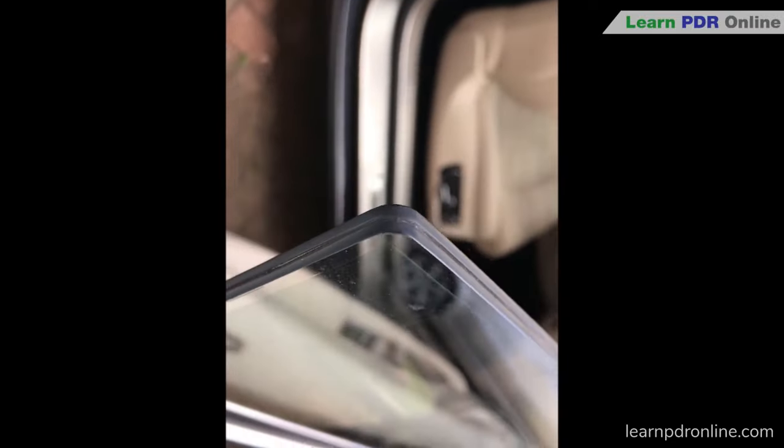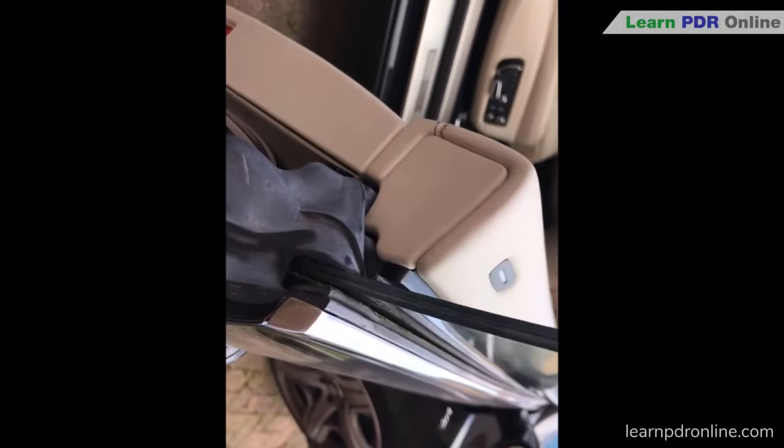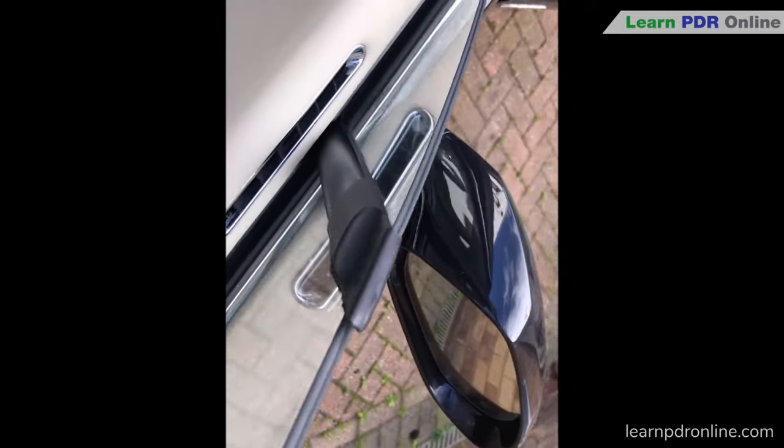The easiest thing to do is look around the outer edge — you can clearly see the two separate pieces bonded together, which is the quickest way to identify laminate windows. The laminate is very strong in the center section but can be very fragile and much more prone to fracturing or shattering around the outer edge, so you have to be careful about your setup and exactly what part you are leveraging on.